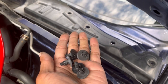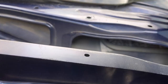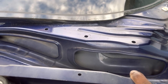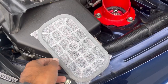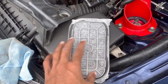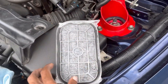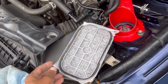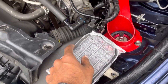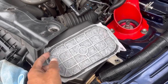To remove this you just need to remove these plastic clips that go all along there. You can see down there the gray edge of it — that oval thing. So this thing is two pieces: there's a base part where you can see this little net, and there's a cover that fits over it. This white paper filter element is actually something I picked up from the local dollar store — I just cut it to size myself and you can replace it as needed. I also added a little foam stripping around the edge just to make sure there are no air leaks coming through.